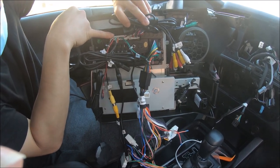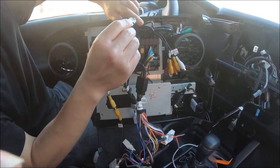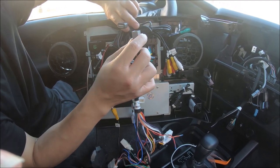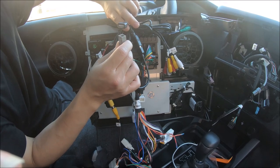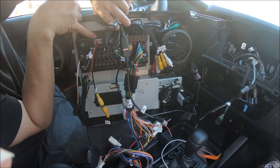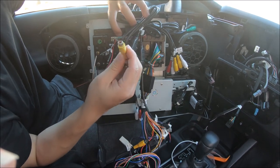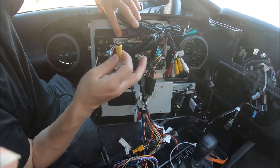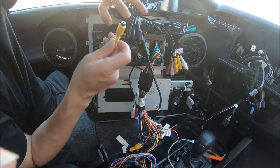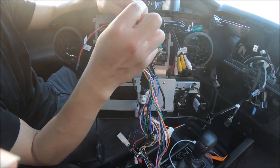Next to it is a six-pin connector that has two USB ports that also do data and power. We've also connected the adapter to support the factory USB port on the radio. The last one is the factory or aftermarket backup camera that has a female RCA. If your vehicle has a factory 360 camera, that is also supported — we have a female RCA and a male RCA coming from the main harness and those two would connect here.